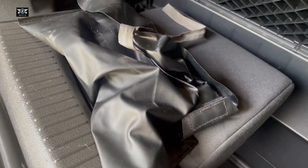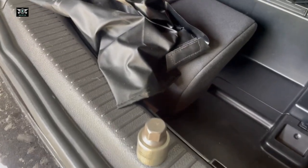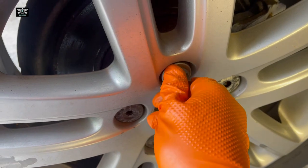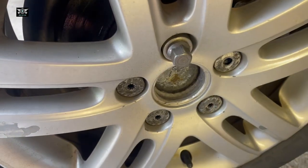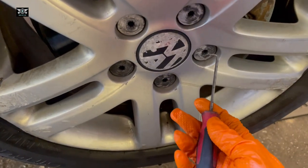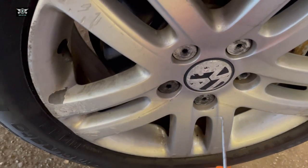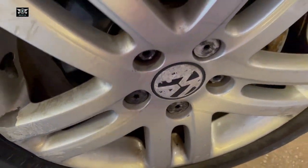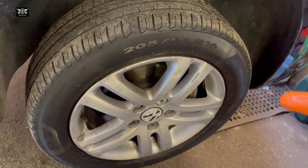I just got it out of that pouch there. If you open this cover back here you will find that set of tools, and in this little pocket your locking wheel nut should be hiding. That will fit onto the wheel nut — there will be a little cover like this one covering it. These are 17mm bolts, by the way. Remove the wheel nuts and remove the wheel, and be careful because these are heavy.